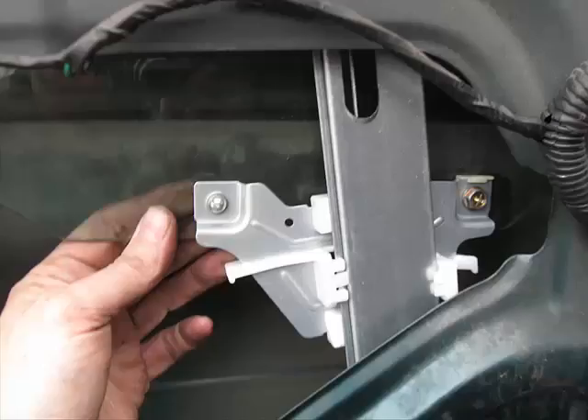Once the glass is out of the way, you can get into the door panel, unscrew the old mechanism after unplugging it, and pull it out of the door — it actually comes out fairly easily. Make sure the new mechanism matches up holes to holes, because sometimes parts companies will send you the wrong ones, so it's always good to match them up before you start pulling things apart.